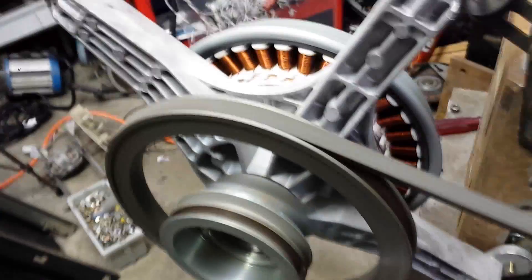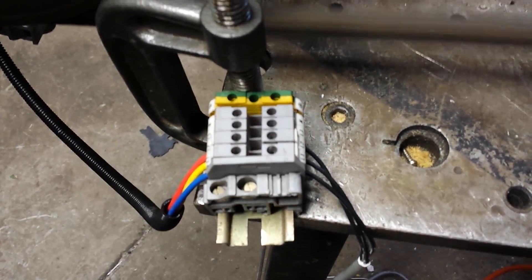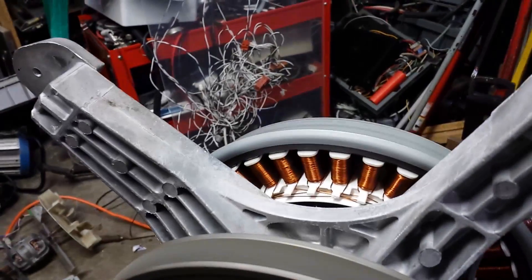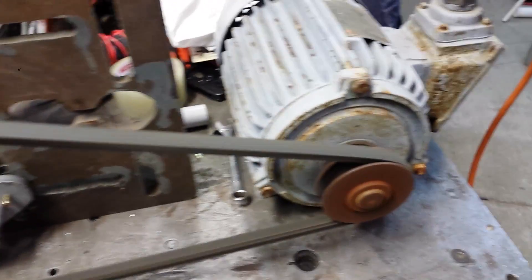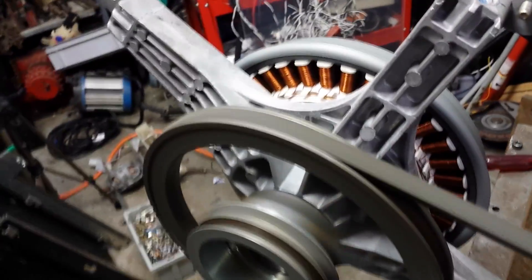It's just humming away happily here. I think the Fisher and Paykel motor at these revs would have blown that bulb to smithereens. It would have done it at half speed, a quarter of that speed — it would have destroyed it. LG just runs a lower voltage. That's all I can figure out — their inverters just run half or a quarter of the voltage that the Fisher & Paykel does.